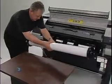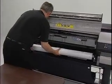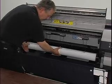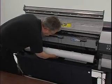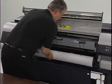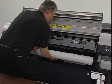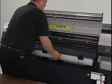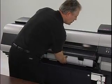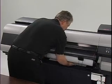Pull the roll paper evenly on both ends, and, with the edge of the roll paper facing the printer, insert the roll holder shaft into the guide grooves of the roll holder slot on both ends. Unlock the release lever and pull the roll paper out evenly on both ends, advancing the paper by hand. Be careful not to soil the printing surface of the roll paper as you pull it out. If the paper is wrinkled or warped, straighten it prior to loading.